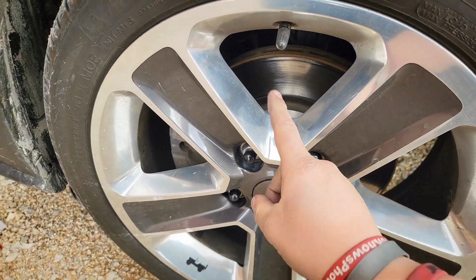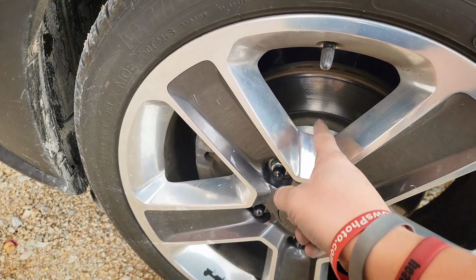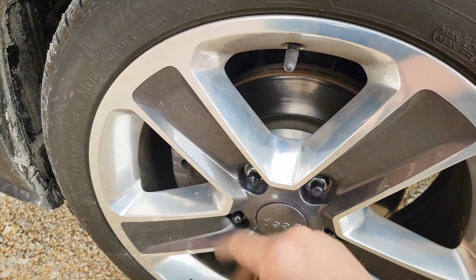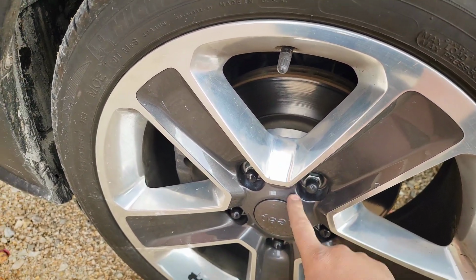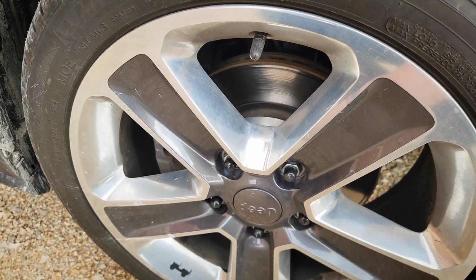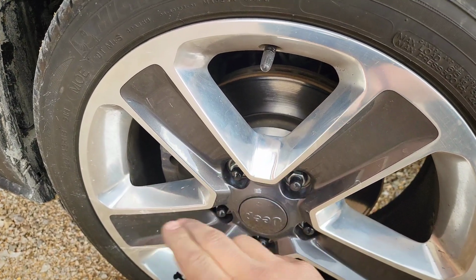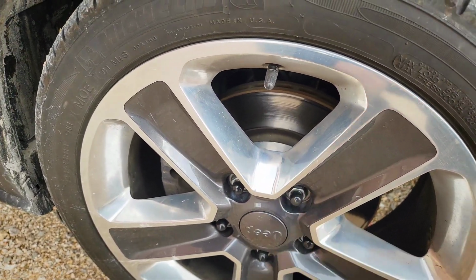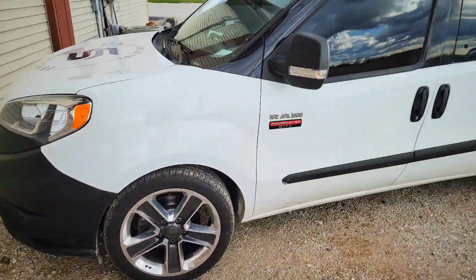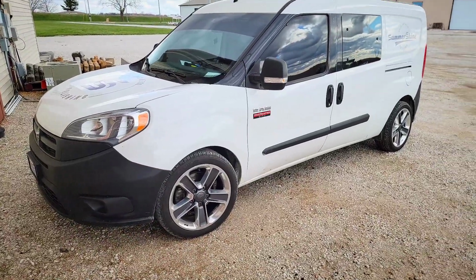pattern. It's a hub-centric spacer, so it goes from the 58.1 hub-centric, or the hub on the vehicle, to the 72, I think it's 71.5 or 3, I don't know, one of those two on the wheel here. You can do your research or even check with US Wheel Adapters because they will help you get the right spacer for this. Now, this video is not sponsored by US Wheel Adapters. I was just very happy with the service that I got from them, and so I want to promote them in this because that's what we're talking about here, adapting a set of wheels to your Ram ProMaster City.